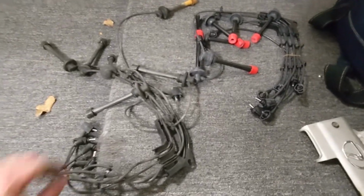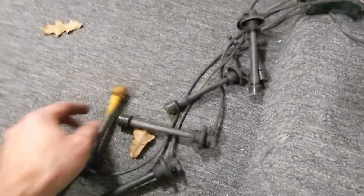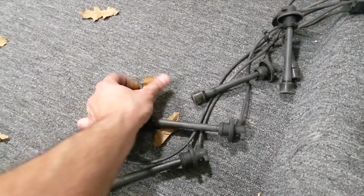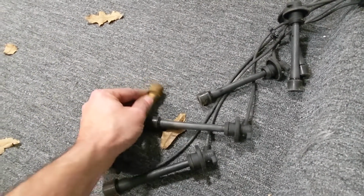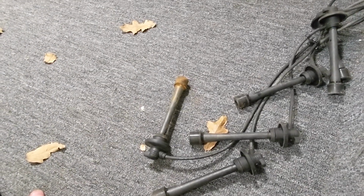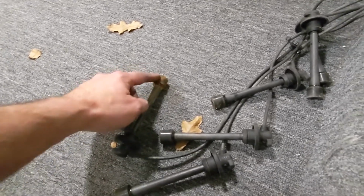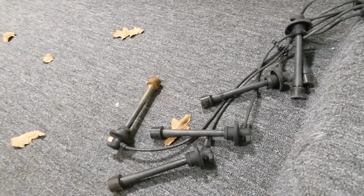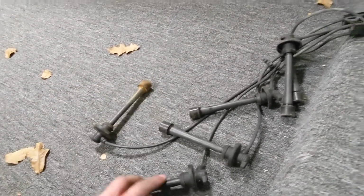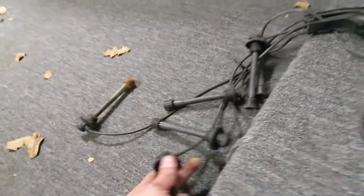Now, watch closely. So, this aftermarket set, you can tell, number 6 spark plug wire in that valley has some old dry rust residue on there. It'll wipe right off. That's from an old heater control valve hose failure where it drips right on top of that guy and went in there. That's since been replaced. It's nice and dry now, but that's what that residue is from. So there's a couple things that I don't like about these wires, and a lot of the aftermarket wires.